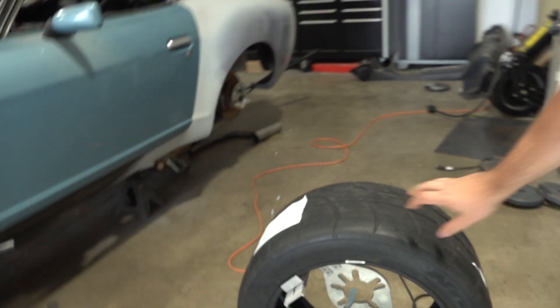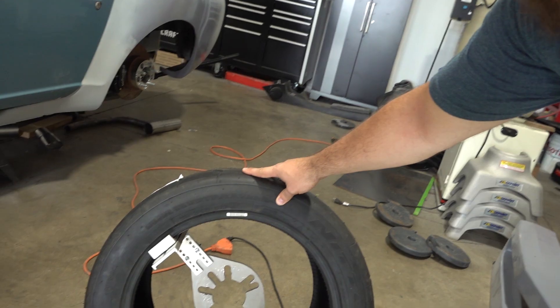One of the benefits of having the tires before ordering the wheels is you can actually get a tool like this one. This is a wheel fitment tool that you can actually bolt to the hub, adjust the offset, move the tire in and out, articulate the suspension, turn the wheel, do whatever it is you would do as though you had the wheel before you've committed to a certain size.